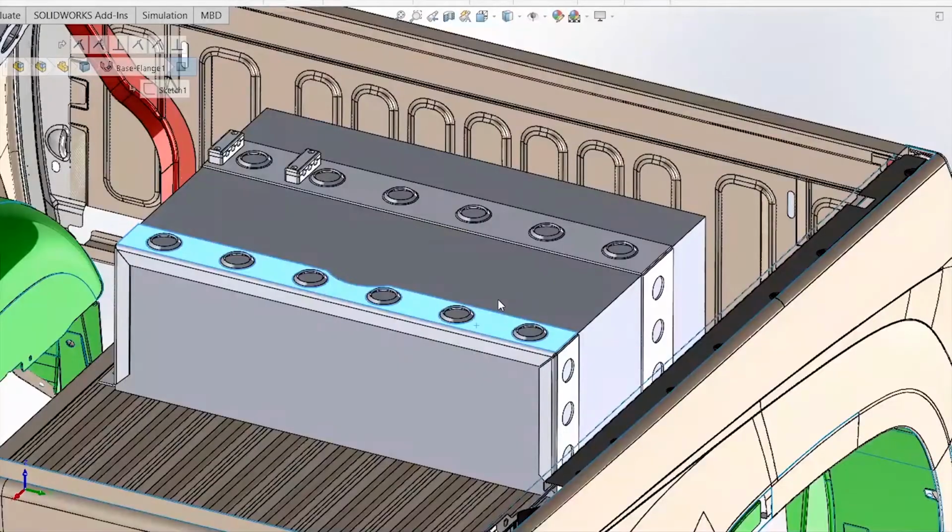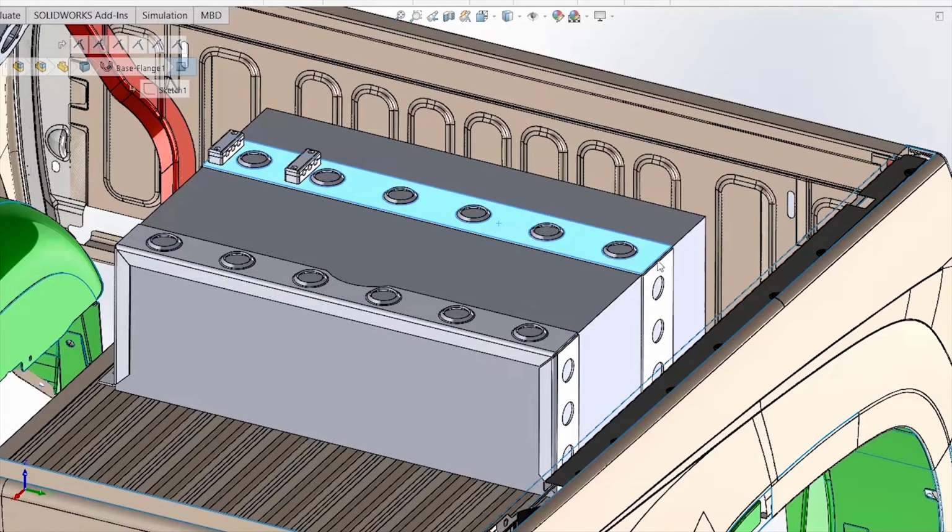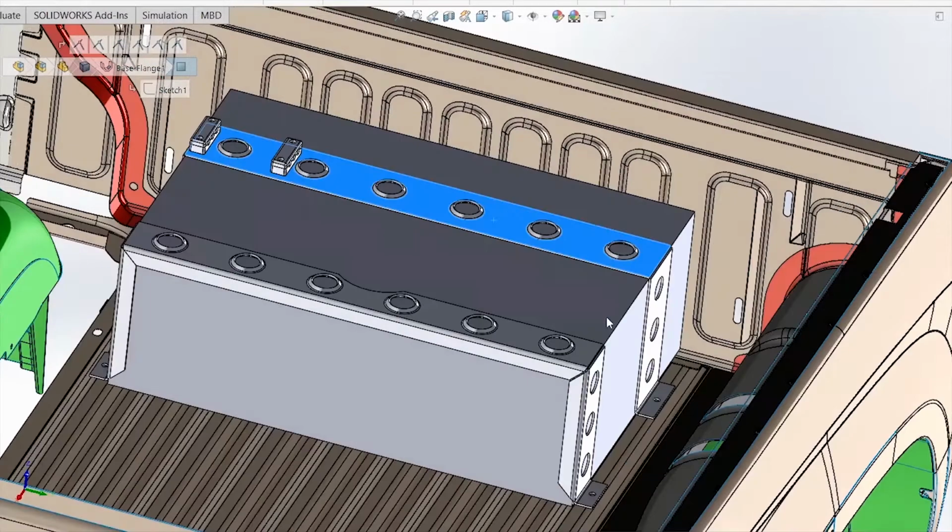Okay, so I had to make some fuel tank mounting straps. Designed these out of 1/8" aluminum. This one on the end is bent 90 degrees to hold the tank up against the front of the bed wall, and then this one is just flat and then wraps around the top. And I added some dimples to all of them.